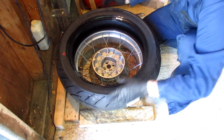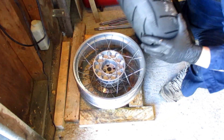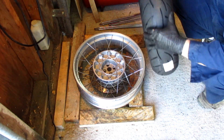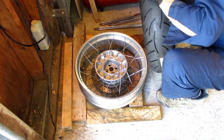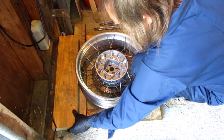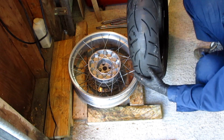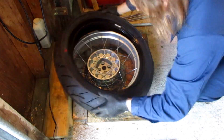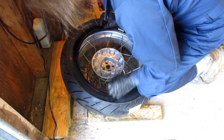The red dot is in front of me as is the valve. I'm going to take my tire at an angle and slam it on the rim. You can even put something behind it to keep your rim from moving for just this step. Red dot, valve — here we go. Put your knees into it.